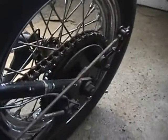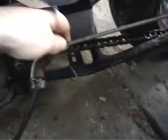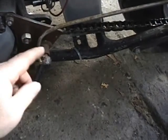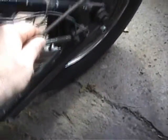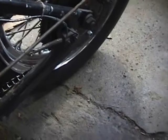Another thing is the way this brake rod is pulling. You'd be scraping the ground by the time you get any kind of brake at all. I don't know who made this, but I thought I pulled caveman mechanics. So I just figured out I'm going to cut this off, shorten it to the right length, put the bend on it, and see how that works — get that to pull correctly so it'll brake properly.